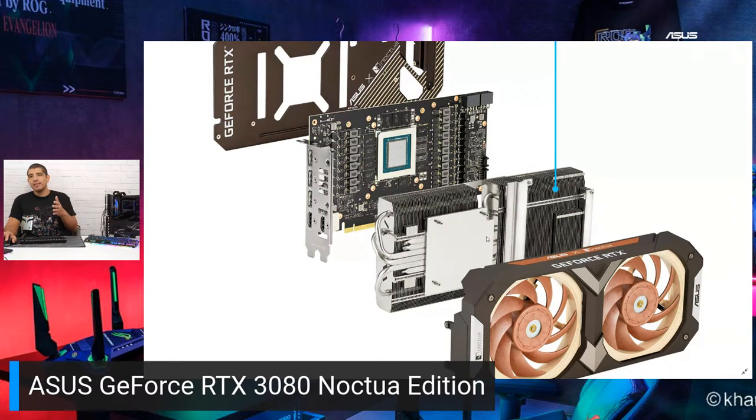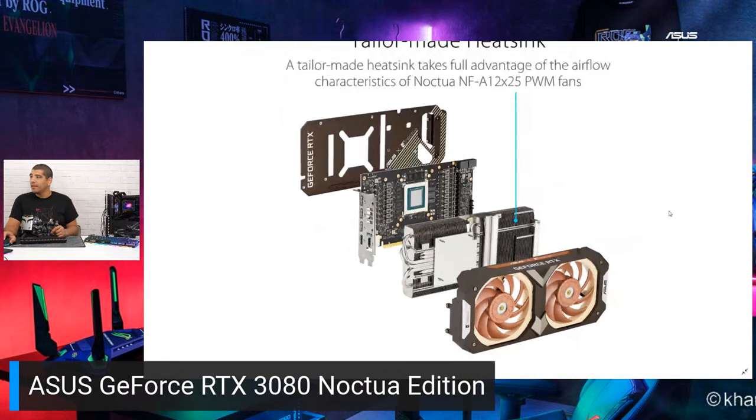So there's actually a heatsink assembly that is for the memory, and then there's the base plate, which makes contact for the GPU. In this design, we've actually enlarged the entirety of that base plate to make contact for both the GPU and for the memory simultaneously. So this is a much larger plate. And the benefit of that is because here, since you have such a high level of airflow and static pressure, it all goes to one plate. And that allows us to not only have lower GPU temperatures, but also lower memory temperatures, and then even extremely low VRM temperatures right there for the actual heatsink component that is making contact with the power stages for the actual VRM assembly. So it's an extremely high performance, very efficient, very, very effective heatsink and fan assembly.